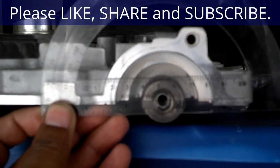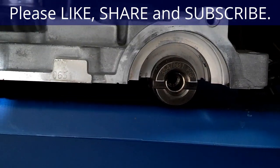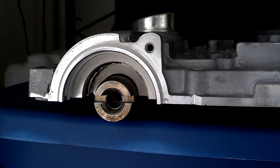I'm done with my cam timing. Looks like I got a plus two on the exhaust, and retarded one and a half or two on the intake. Then I went around the front and aligned the cams and secured the bolts so that the cams are aligned to where they need to be.